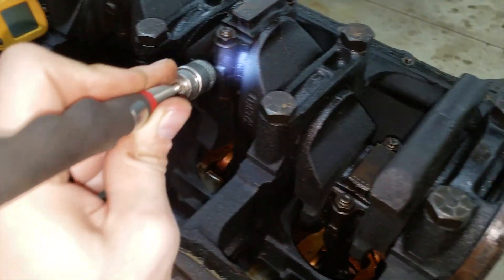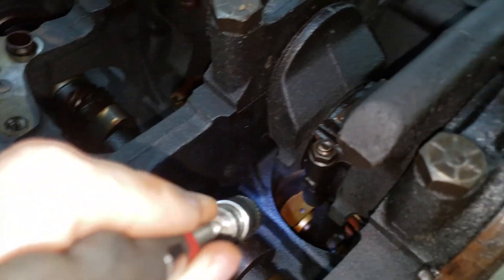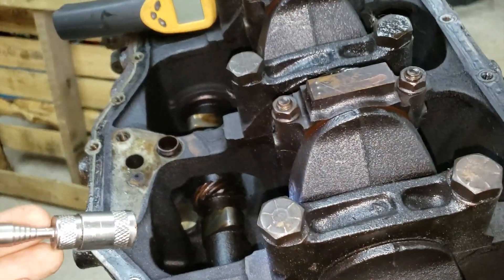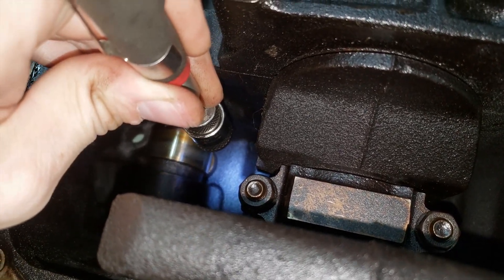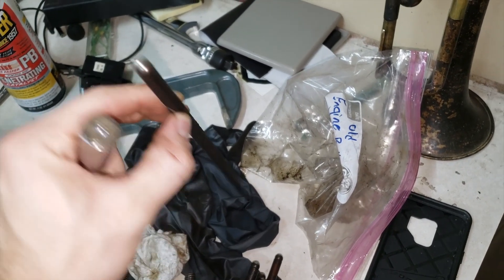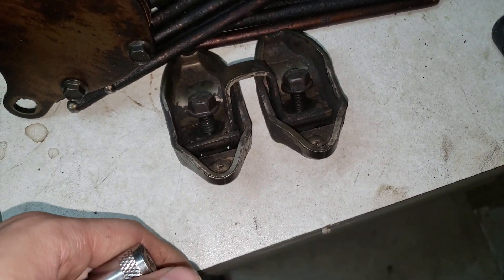At this bearing point you can see another oil path which goes and lubricates the bearings for the camshaft. At some point the oil comes out and fills the pan yet again. Additionally, some of the oil that is in the lifters is going to go through the push rods — push rods which have holes in them. The oil travels through the push rods, comes up through the holes in the rockers, and then lubricates the moving parts of the rockers, at which point it falls back down into the oil pan.